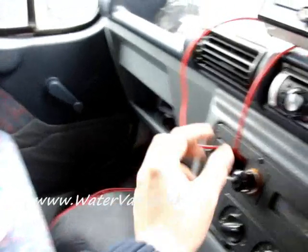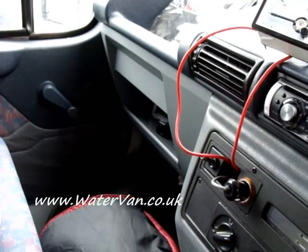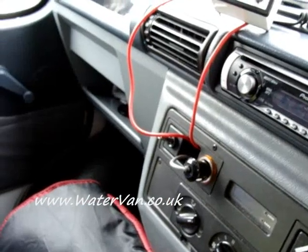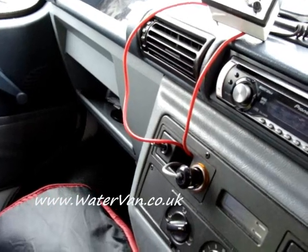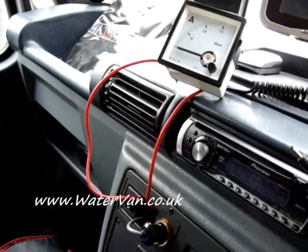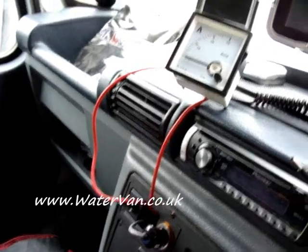Because this wire is rated up to 27 amps, so I don't want to be going more than 25 really. I'm going to try and keep it below 20 — I don't want it going too far over. So that's the new temporary arrangement. We'll see what the MPG rate is like at the end of the day.